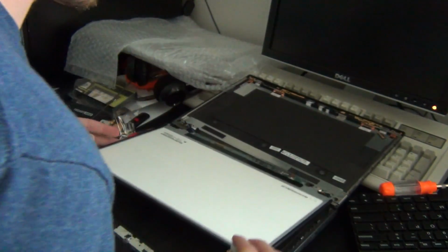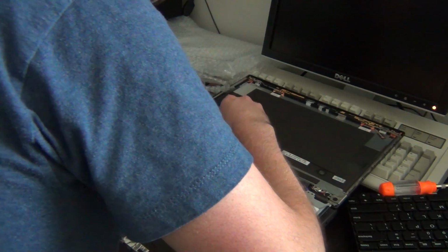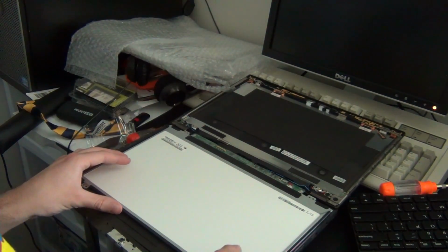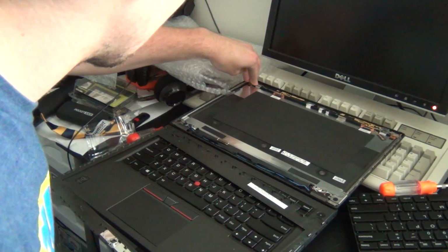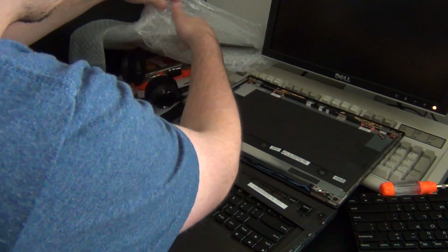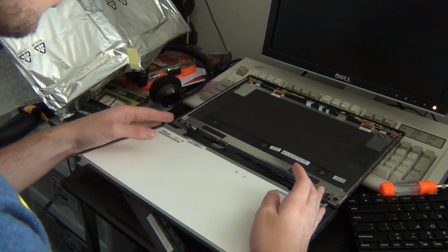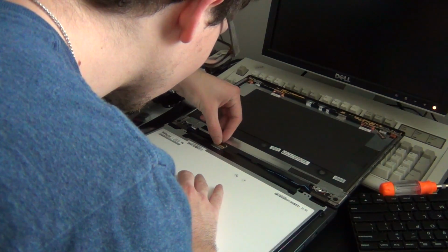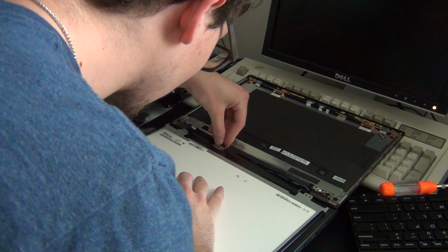Flip it over as if you're closing the laptop display, except just take the screen and not the back of the display housing. Then carefully remove the EDP cable that's connecting the display to the motherboard. Then you can dispose of the old display or put it somewhere for safekeeping. Line up the new display like you had the old one aligned, as if the laptop is shut, and then carefully connect the EDP cable to the display.